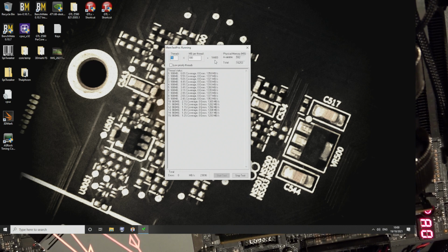It's cheating. So if this doesn't spew out any errors, I'm going to just run this to the usual 400%. If I was actually going to be dailying this, I'd also want to run LinPack on it, and Y-Cruncher as well. Yeah, LinPack, Y-Cruncher. I'd actually leave this overnight. LinPack would be just for a couple minutes, like 30 minutes of LinPack is normally what I do.